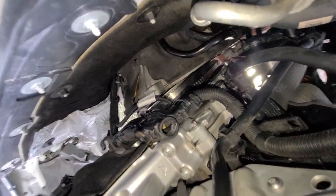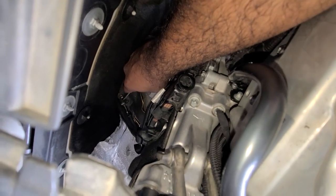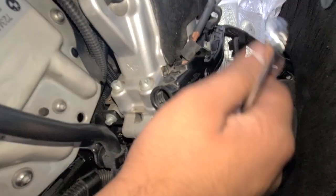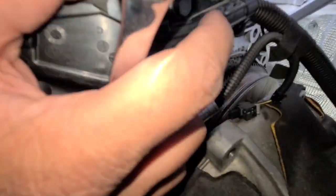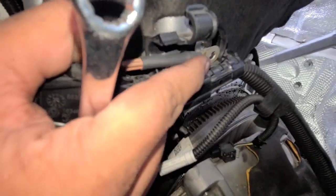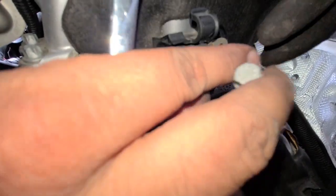You can see a jack between the transmission and the cable itself is routed on the engine, so you need to remove that jack. And here you can see a bracket supporting all the cables, the wiring from the transmission, so you're just going to be removing these, removing the ground. So I'll show you where that goes. Two bolts are going to be removed here, and then the bracket would come out. You can actually see the jack lying down there as well.